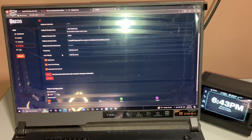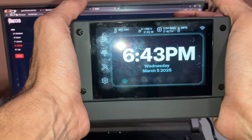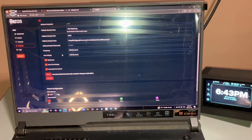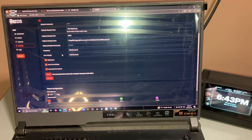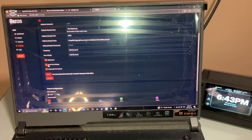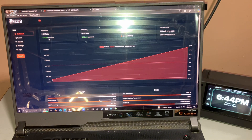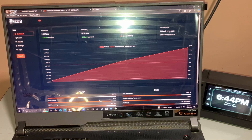All right guys, part three to the video — I got the high power mode working and I think I know what I did wrong. When I put it in high power mode I had my hands blocking it like this, so there was no air coming through and I overheated it that way. What I did was go into the AxeOS settings, change the frequency and the core voltage, clicked save and reset, then went into the BitAxe Touch and put it into high performance mode — and it worked. I've seen it go up to 1.6 to 1.7 terahash; right now it's at 1.52, which is what it's advertised at, though it drops to 1.3–1.4 sometimes.